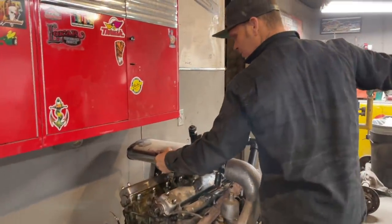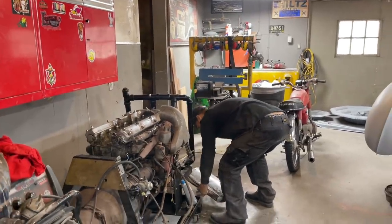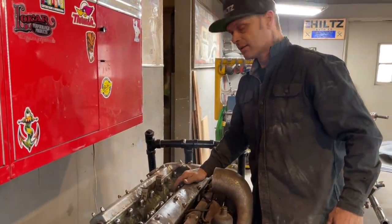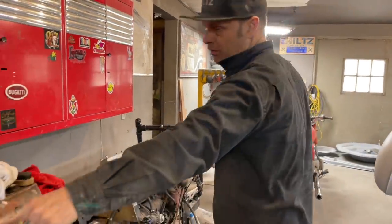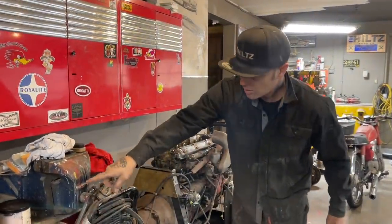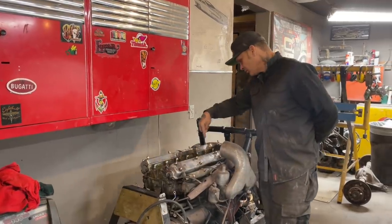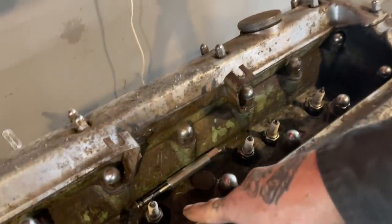Just trying a breather on here from Jolene's engine that she bought — it fits this engine, so I'm just checking that out. We got all three of the spark plugs out. Jim had it soaking in transmission fluid for years, that's what was in there. When Doug first started we were spraying it with Crown penetrant. We did the candle thing when Jeff came over and gave us that piece of advice — if you do not have penetrant, do not have heat, there's the candle thing. We got them all out. You can see the wax around each one of them.